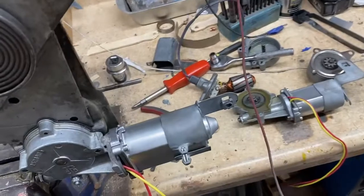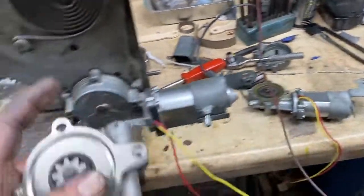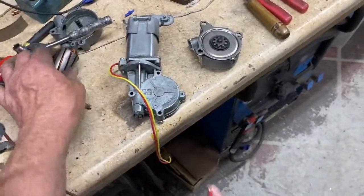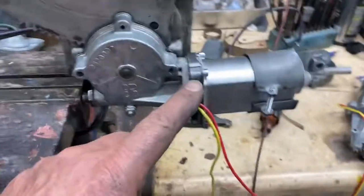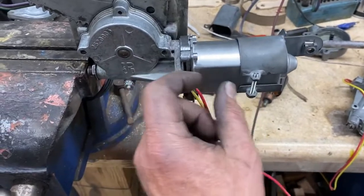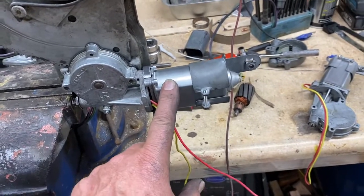I went online and picked out some aftermarket electric window regulators with motors on them. Unfortunately, this portion of the motor was not compatible with the gear arrangement on our original. So what we did was take the bodies of those motors, cut off the drive shaft on the armatures, loaded it into the motor — the original head, the original screw drive — intersecting the two, the motor shaft with the worm drive, adjusting the end play, and using these much more powerful permanent magnet reverse polarity motors.